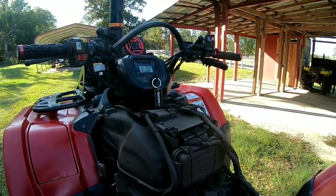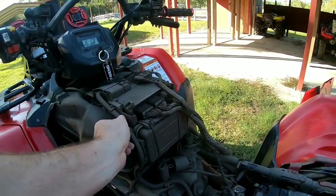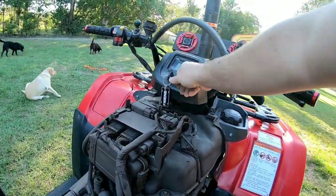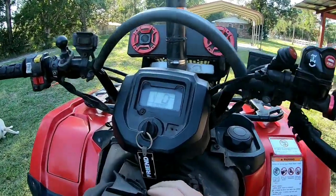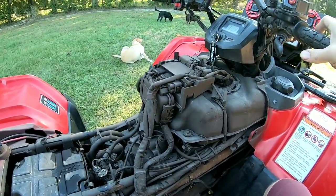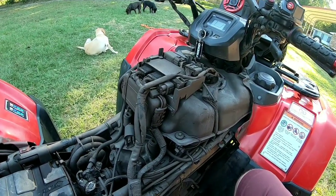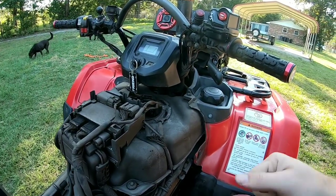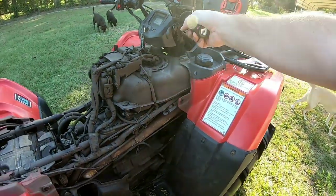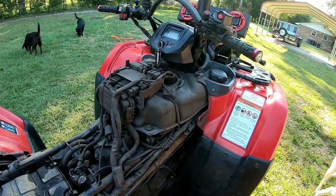Manual actuators are coming for some of you guys, and I'm even looking forward to one myself — only because of the simplicity of it being no longer electrical, even though mine is working great. With these electronic systems, whenever you actuate four-wheel drive it'll flash until it locks in. With a cable-actuated pull-type actuator, whenever I want to use diff lock, I pull the cable and I know it's locked — no backing up or playing with the steering wheel to confirm engagement on the screen.